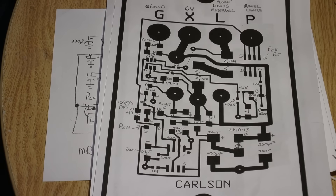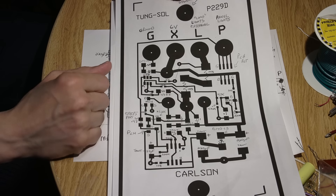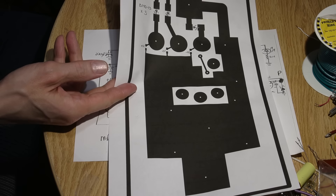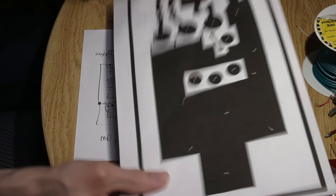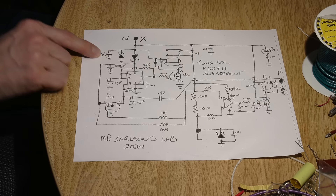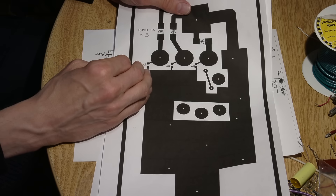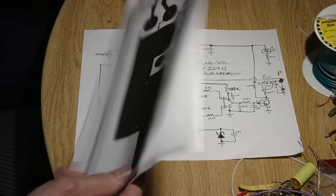Here is what it's going to look like on the actual circuit board — already drawn in with all the part values penciled in. This needs to get built now. This is the front side and this is the back side of the board. It's going to be a double-sided board. There are a couple parts on the back side — the 0.01 decoupling caps — one right here, one here, and the other over here. These are 0402 parts, just a mixture of everything I have on hand that's just in my junk bins. This is really large so I can mark the values in — it's a component layout map.